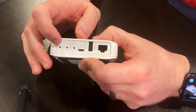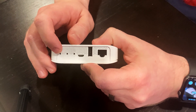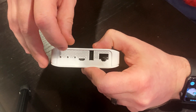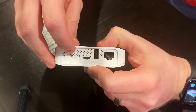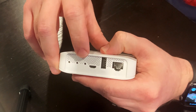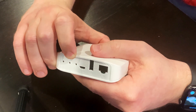I've taken a look at the manual. Button one: press and hold for five seconds to reset the Wi-Fi radio and put it into setup mode; a single tap turns Wi-Fi on and off. Button two is a Zigbee reset switch — according to the manual you should never press that unless told to by a support engineer, as it will drop your connection to the smart meter. Button three the manual just says should not be used, which kind of makes me want to press it, but I'm not going to. I'll drop a link in the description to the full manual on the Rainforest website.